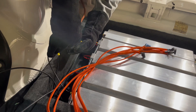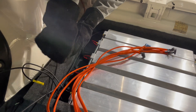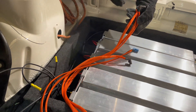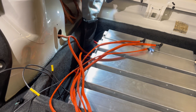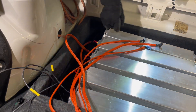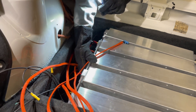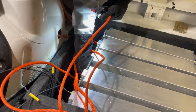Now I'm disconnecting the service connector — also very temporary. When I do so, I divide the battery pack in the middle, so the voltage will now be around 190 volts, which is a little safer to work with. Now I'll connect the balance leads — each balance lead covers up to 12 cells, one module. In total we have 8 modules and 96 cells.